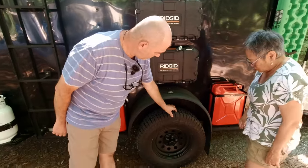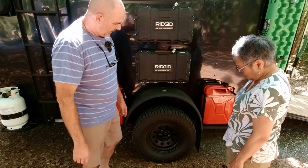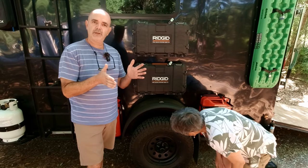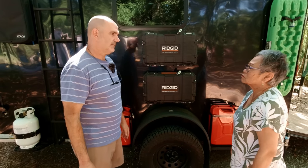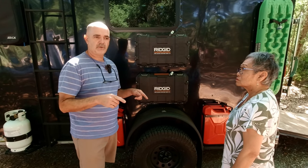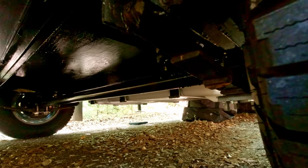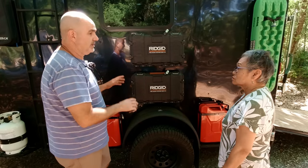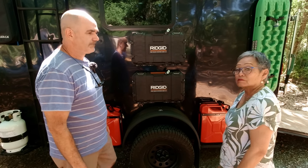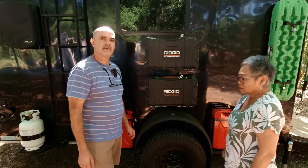I got off-road tires. I had to buy a different rim — 16-inch. This had a 4-inch drop axle, so I installed a 3500-pound straight axle with brakes. Now I've got brakes to assist my truck, and once it's all done it's going to be heavy — that's why. Brakes on the trailer are so important, especially when you start outfitting it and putting heavier gear on board.